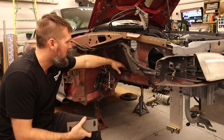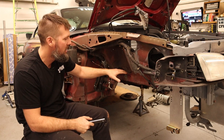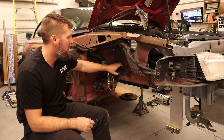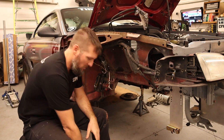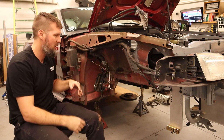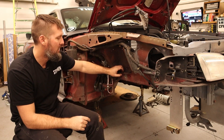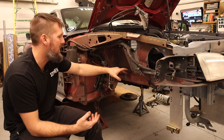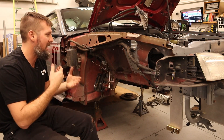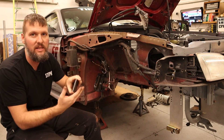I need to first figure out what we need to do on the car. It has this pinch weld right here, which I knew about. I've seen other designs that kind of go around that, and I've also seen some that do something with the pinch weld to get rid of it. I haven't quite decided yet if I'm going to cut it and bend it down, bang it down with a hammer, or cut it off and weld the two pieces back together to stiffen it back up. If I just bend it down, it still has some thickness there and I can't put this flat up against the frame anyway — it needs to step off of there.